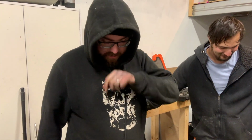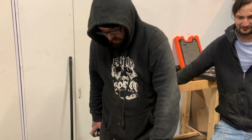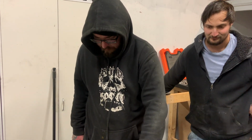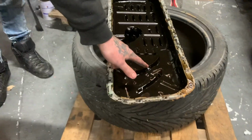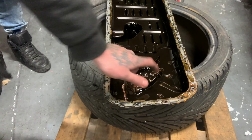Anyone wanted to follow up on an aim? So, someone was saying the other day, looking for an RB sump, and I'm not going to mention names, who commented, it was like, oh, just get any RB20, RB25, or RB30. They're all the same. Now, I mentioned the fins in the RB20 and RB25 sumps that the RB30s don't have. So RB30s don't have these three fins inside them. So if you fit an RB25 sump to an RB30, the crank will hit those.